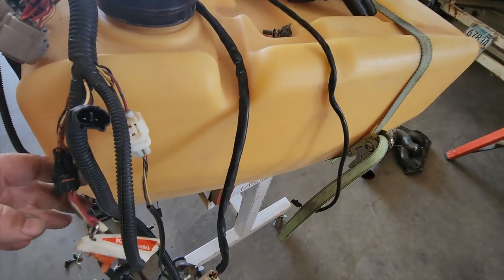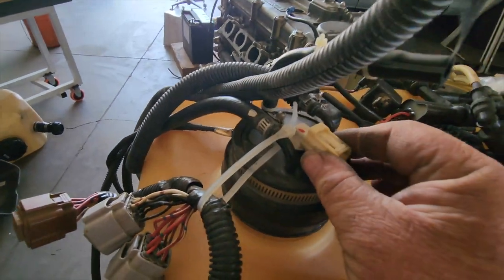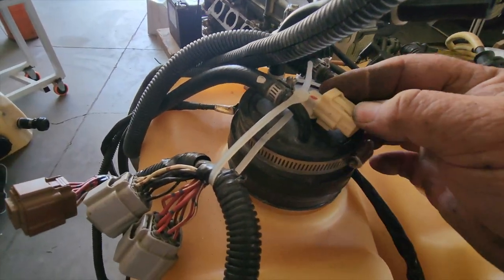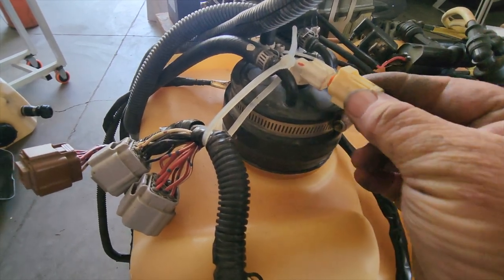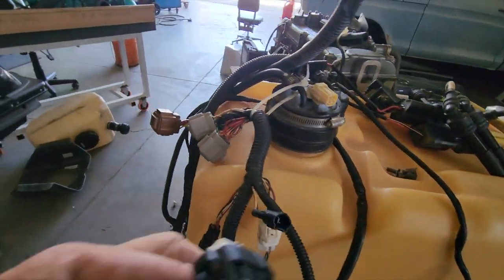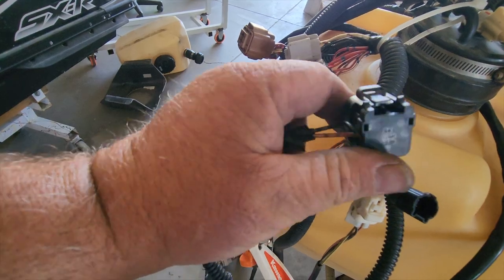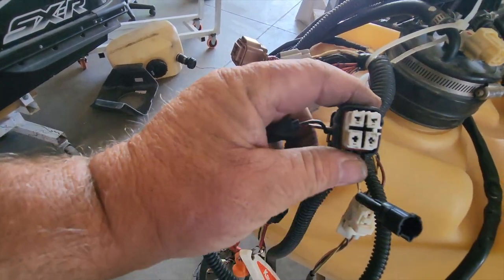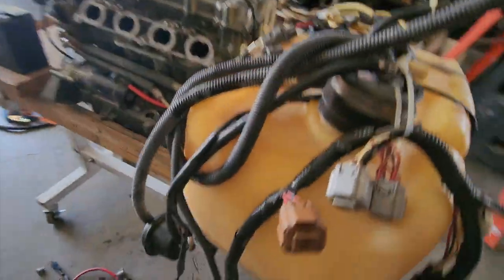And then the fuel pump. The fuel pump connectors are from the same family, so I was able to just unpin those. This is the 12F fuel tank, and this is the 1500 connector. So I was just able to push those pins in, and I didn't use the fuel gauge ones. So put those together there. We come back around here.